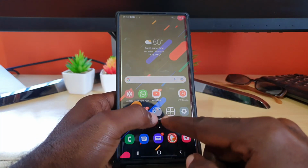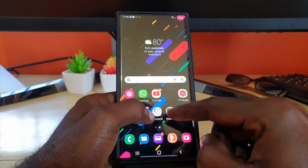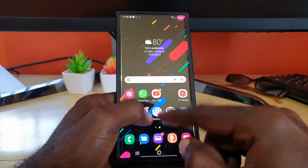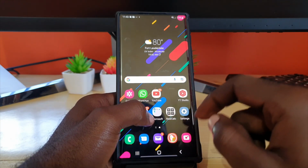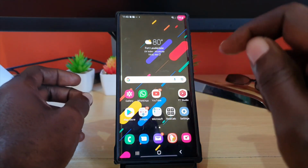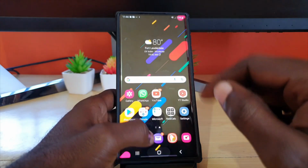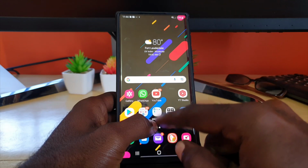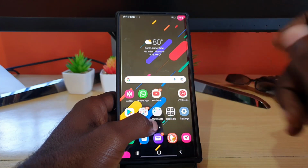Also make sure that the screen protector has not gone above or is covering the area here, because it's a special composite material in this area that should be placed directly over this fingerprint scanner, which is directly in this area. So that might have been the issue. It would be best to get a screen protector that has an installation guide or a frame that allows you to place the screen protector on perfectly. If not, that could be your issue. So the screen protector could be the issue. As I said, if it's not making perfect contact with the surface for this area where the fingerprint cutout is made with a different material, it's going to cause issues. But if you have installed everything properly, just do what I said and it should be good.